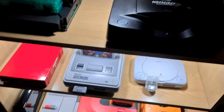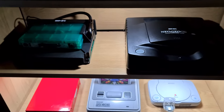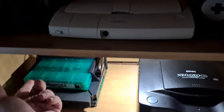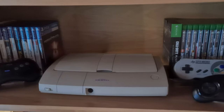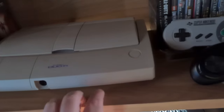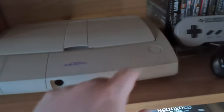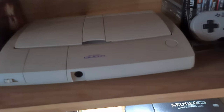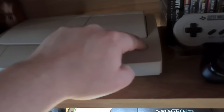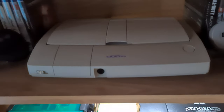But that's my systems on the shelf and what I've had done so far. I've probably missed loads out and absolutely messed it up, but I just wanted to show you what I'm playing and using at the moment. Next thing on the list: puck lights. All I need is a set of four — one there, one there, one there — and then these will all have soft boxes sitting in the middle nicely. Also, not really a mod but just a little tip: if you've got a Duo R and you have an eject button that is very, very stiff — take the lid off, pull the button out, get yourself some carnauba wax. Put it on a cotton swab and rub it along the rails, inside the button, on the edges, on the eject system. Put it all back together and then you can eject gently — whereas before it was a pain in the arse.